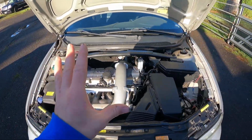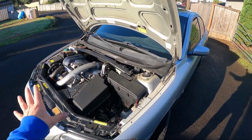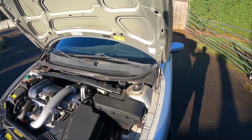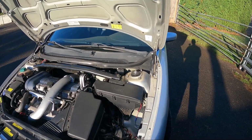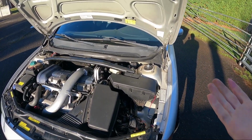As you guys know, I had symptoms, meaning all of a sudden the car would not start. It would crank but would not start. It would show random messages: service traction control, service transmission, and then I would have to do an immobilizer reset procedure that I posted on my channel, and then it would start.